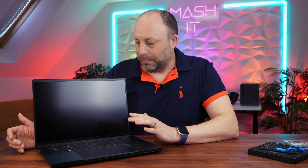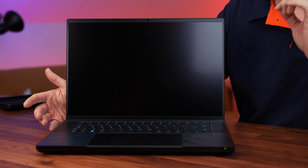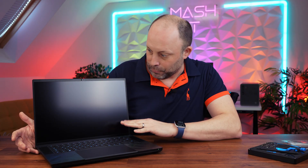Now powering back on the laptop. I want to warn you that whenever you change the RAM and unplug and replug the battery, it can take ages to boot back up the first time. I've had some machines take up to about five minutes after changing the RAM. So please be aware — don't panic if it doesn't come straight back on. Go make yourself a cup of tea or coffee, come back, and hopefully you're back at the login screen.